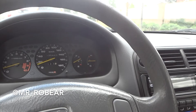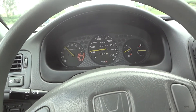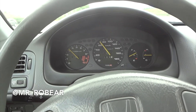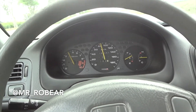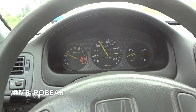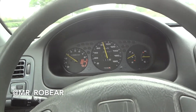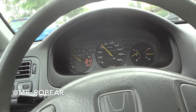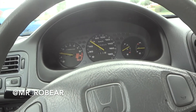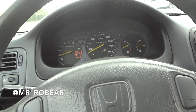Go ahead and hit the brake, go to neutral, and coast. The last step: from a stop, accelerate at three-quarters throttle to 55 miles per hour and try to stay there as much as possible. That should be good. We're gonna go back to the house and do the test to see if that drive cycle actually worked. It only took about six miles, but from other videos it usually takes ten to twenty.